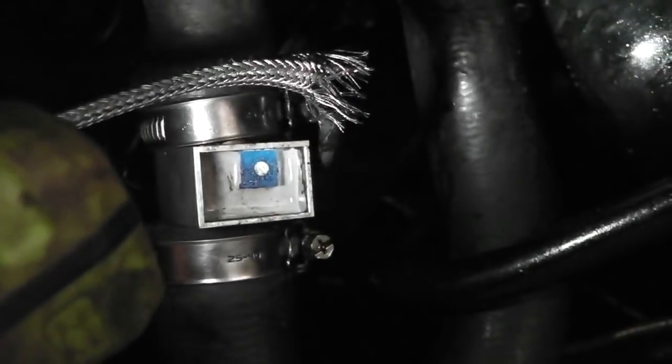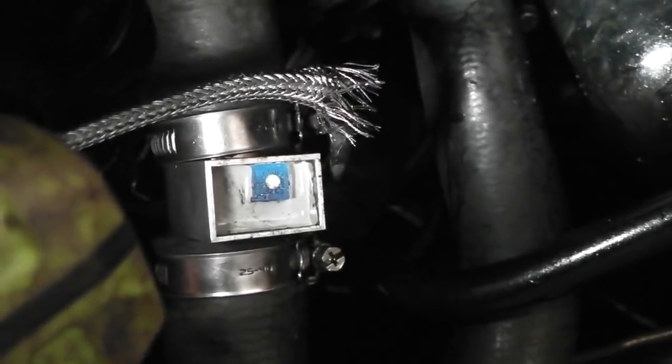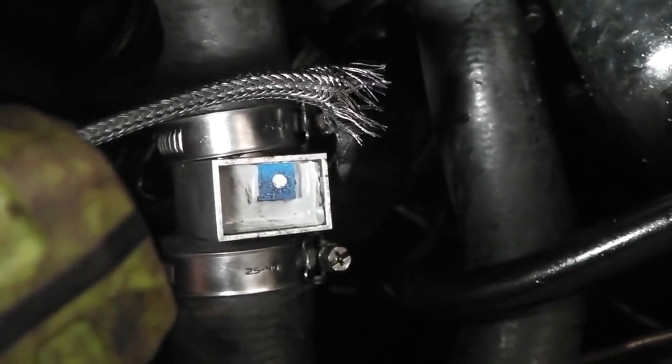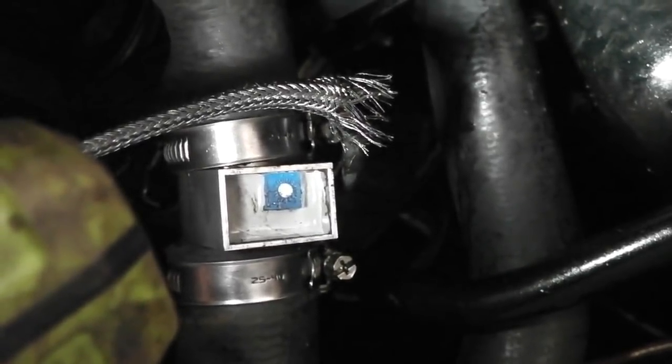I just realised I hadn't filmed the controller stats. So it's got that little braided loom coming out. That one's tidying up at the end, it's frayed, so we'll put some tesa tape around there. We might even put a better tape on. Tesa is good, it's a cloth tape, really good stuff for doing wiring loom wraps.